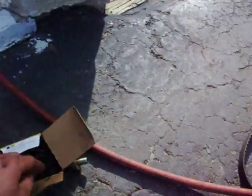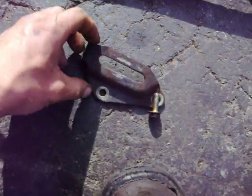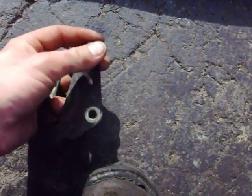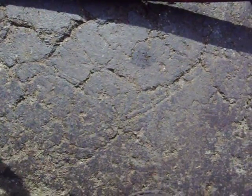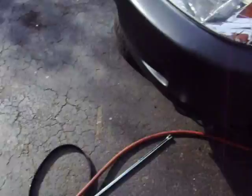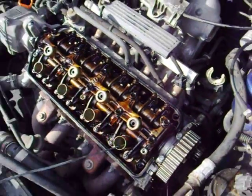When you're taking off the belt drives, you're going to come across the pulley holder — I believe this is the AC pulley. Take it right out or else you can't get the timing cover off. Make sure you also take the oil tube out of the way — it slips all the way down in here. It's a pretty simple, straightforward procedure.